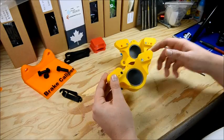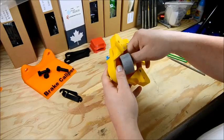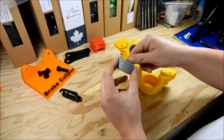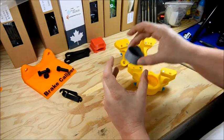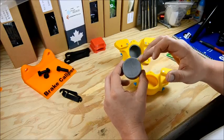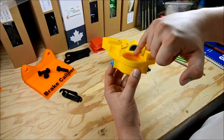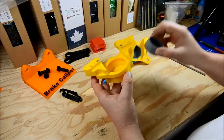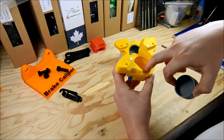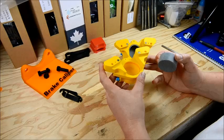To get out each piston, I usually just grab it — one thumb on each side and slide it out. There's your piston. Pretty simple. A little sanding and you want to get a nice fit. You don't want the piston falling in and out. When you're fitting it to the caliper body, you want to make sure you've got the piston ring in the caliper body before you start trying to fit the piston, because it's most likely going to change the fitment — your piston ring is going to probably print with a bit of flare on a typical desktop printer.